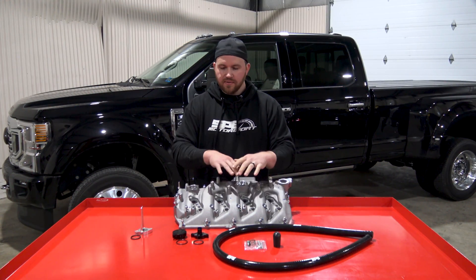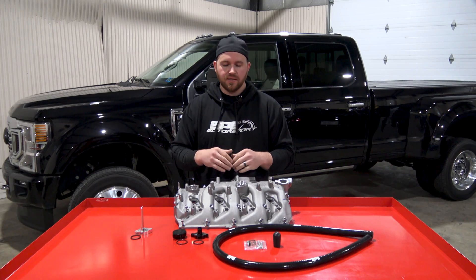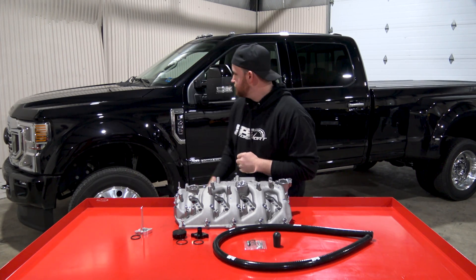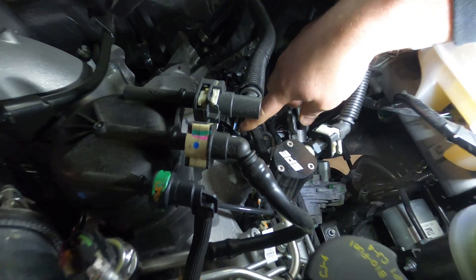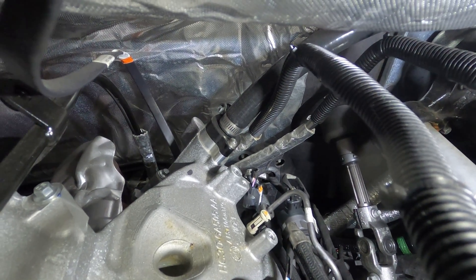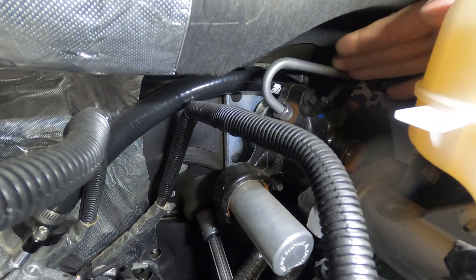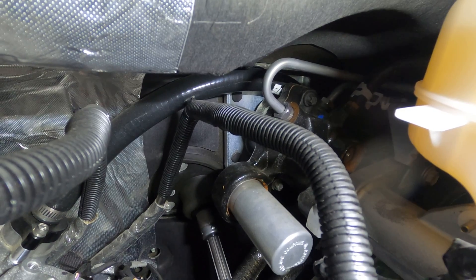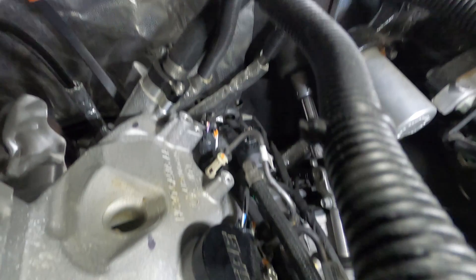Now that we went over everything on the table and the functionality of the crankcase vent system on the 6.7, we'll pop the hood on the truck and show you what it looks like laid out. Now that we're under the hood, you can see each of the components. This is the void in the engine bay where the CCV box used to take up space. That's the oil drain back plug there. In the back you can see the internal catch can and the adapter for the hose on top. The silicone hose runs out of there — we route it up over the brake booster because it keeps it from kinking, then down the backside of the inner fender underneath the truck. That's the routing we recommend and it works the best.